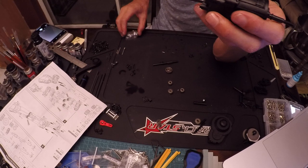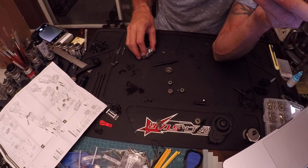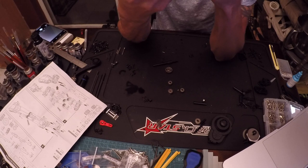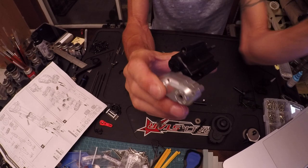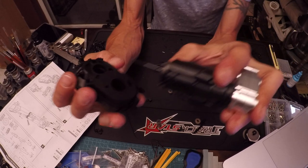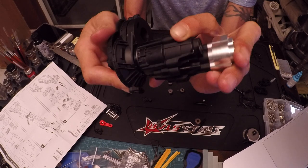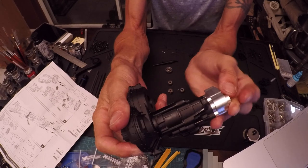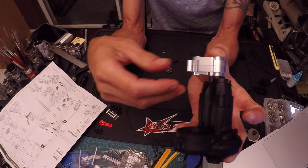What's going to happen next is we will install these other small miscellaneous gears, and they will go into this transfer case, which will then mount up like this. Transfer case will mount like that. We'll put the slipper clutches and so forth in here, and then this will end up on here like this. And then we'll mount our 35 turn axial brush stock motor.